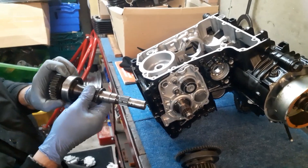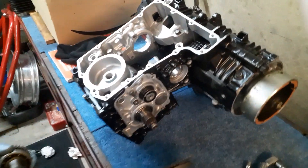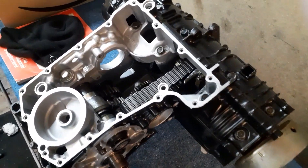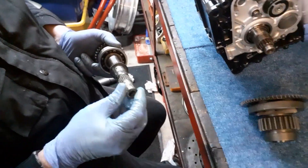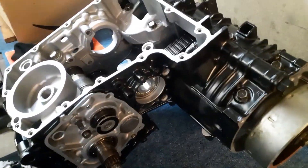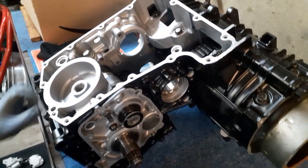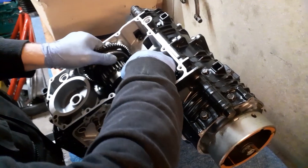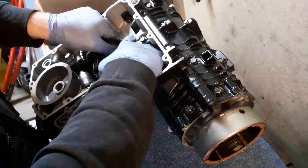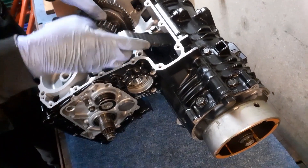So to fit this I've just got to remove that shaft. It's kind of similar but different from the big Z that I've been working on. The transmission's all in, all reassembled. It goes in sideways, it goes in through here, and that's got to assemble. We were saying this is possible with the engine in the frame, but it ain't — it's not easy because you've got to tip the bike over. It's quite awkward to do.